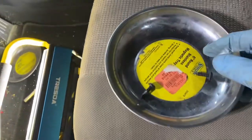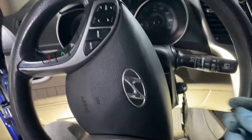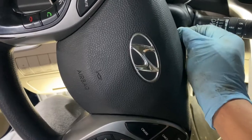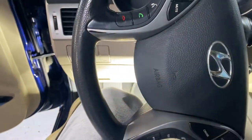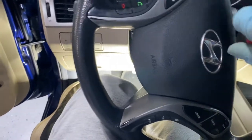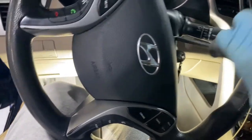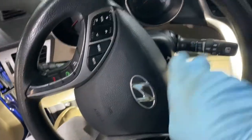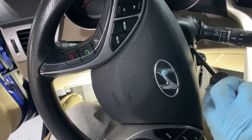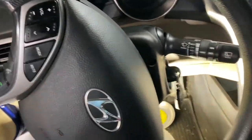And that's it. Oh, we have two more screws. You know what that is? Right in the middle. Remember this? In the steering, turn right and left, they go in that spot. Never forget that. I know a lot of people forget that to install, and that plastic behind that steering will start moving and it will have a noise because it's rubbing. This piece is rubbing on that and it's annoying.